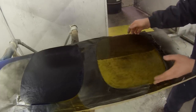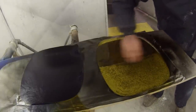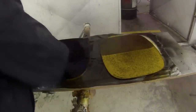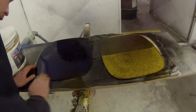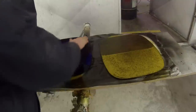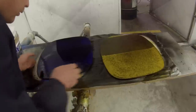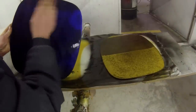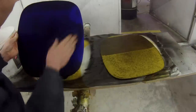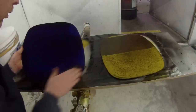In a practical use these are just test panels and I don't really care how they turn out, but I reckon it would be great for something like a motorbike helmet or motorbike tank. You really are limited by your imagination — there's nothing stopping you from putting this down, putting a coat of clear to seal it down, sanding it back, doing some airbrushing over the top, getting crazy with masking, or even doing candies over the top of it. Just do some tests and see what kind of results you can come up with. On the blue one, because those panels aren't dead flat and have a few ripples, the sections that are deeper blue is where it's pulled up and been a lot thicker, giving a totally different effect.